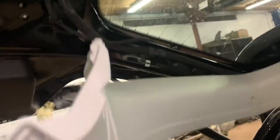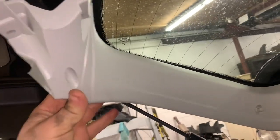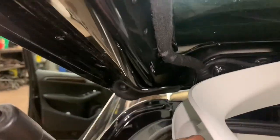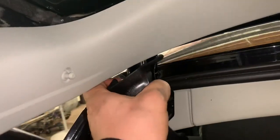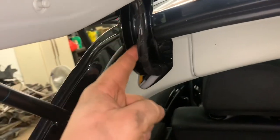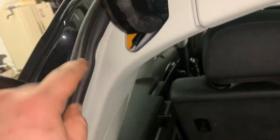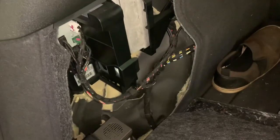Getting this panel down was a bit more difficult — pull it kind of towards you. There is a clip here and a clip here where you can see the wiring harness. I pop this cover off right here — if you pry slightly outwards it'll pop down. You can pull that out and see where the harness goes through, and then we are going to pry this weather stripping back and route it down in this direction into this section right here.